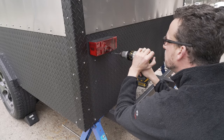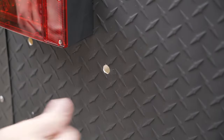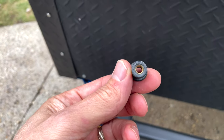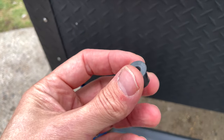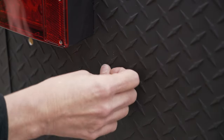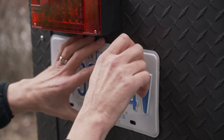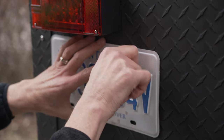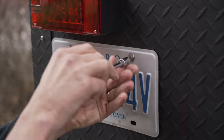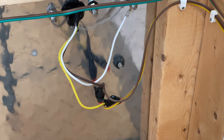Then it was time to put my license plate on. To install the license plate, I drilled holes in the aluminum, and I decided to use well nuts for the two holes for the bolts attaching the license plate onto the trailer. These are handy little tools — you put them into the aluminum, and when you tighten them up, the rubber compresses and makes a waterproof seal.